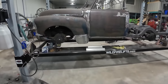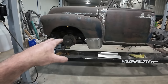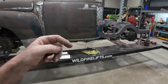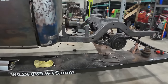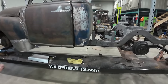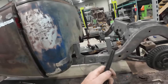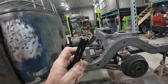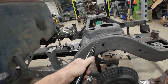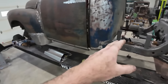We're back at it again here. So, this round, still haven't got anything for the brakes. Not really worried about the front stuff because that's really easy to do. Like I said last time, we have our needle scaler. So I think this round, the plan is to get some paint. The way I'm tackling this, essentially this is a needle scaler. It's like an air hammer with a whole bunch of needles. So you just go over it and it should knock all this loose stuff off, to which then we can zap it again. So I want to do that.